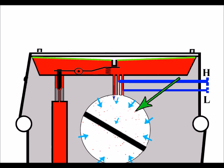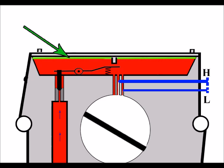There's big differences there. So should you suspect that the metering diaphragm is at fault, they're easy enough to find on the internet and they're quite cheap. I normally buy them in a kit, so I get the full diaphragm kit for the whole carburetor and I change everything while I'm at it. And that way I know everything's okay.